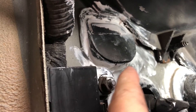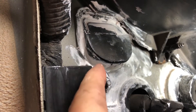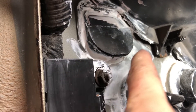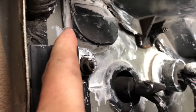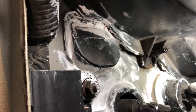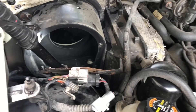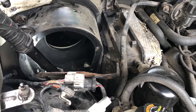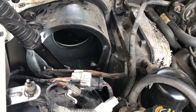I suspect it's coming from here, so you can see now I've just sealed up around the between the firewall metal and this plastic drain. So I think that if you're under here doing these two you should do this one as well. Hopefully this will be the solution to all the leaks on the passenger side. So the solution there was not really the solution - that last caulking that I did didn't really help, so we still have a drip inside.